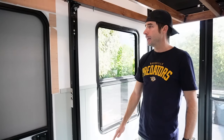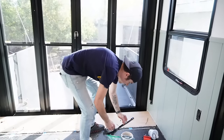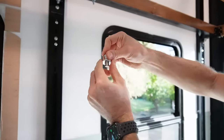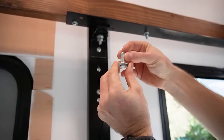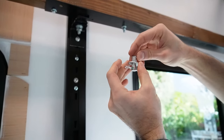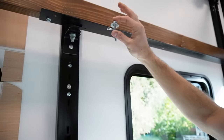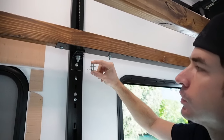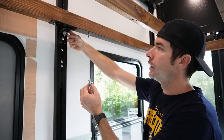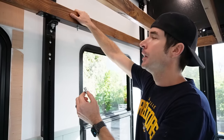Each corner of the Happy Jack system had one of these little through bolts with a cotter pin and a washer. The problem is that while it's secure with the original aluminum queen frame, it wiggles. Our bed frame would wiggle too if we left those in, so I removed them and replaced them with 7/16-inch, inch-and-a-half bolts with washers and locking washers on all four corners. That made it much sturdier so we don't have to worry about wobbling.